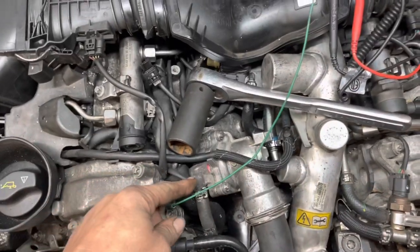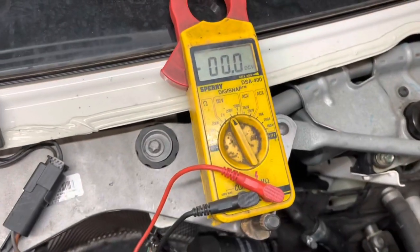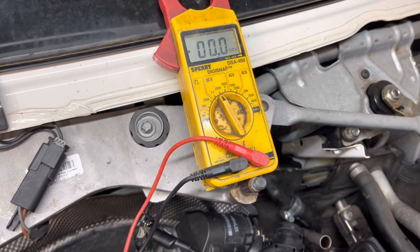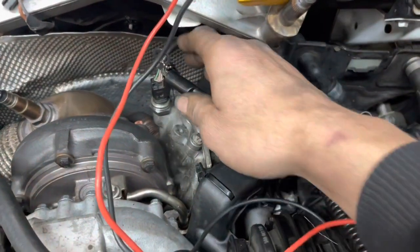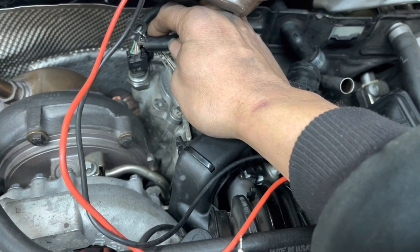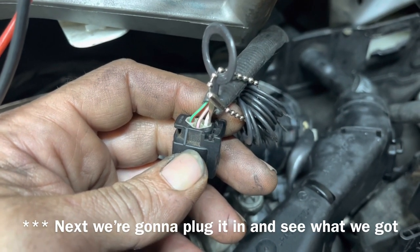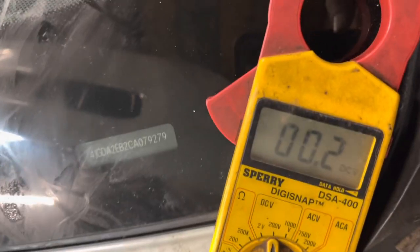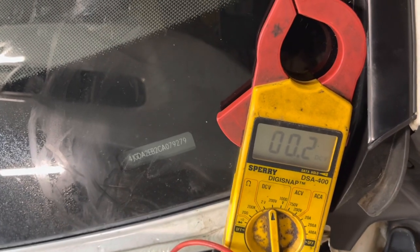For the very last test, we've got one alligator connector to a ground running into our ground side of our voltage meter, which is set on 200 volts DC. With the sensor installed and the engine running, we should get 0.5 volts or higher. We've carefully inserted our probe and hooked our black alligator clip to our positive side of the voltage meter. This is the output side — the white wire — which sends the voltage signal to the ECM as the vehicle is running. With my sensor plugged back in, I work the throttle and the voltage should change, but it's not — so this confirms we have a defective sensor that needs replacing.